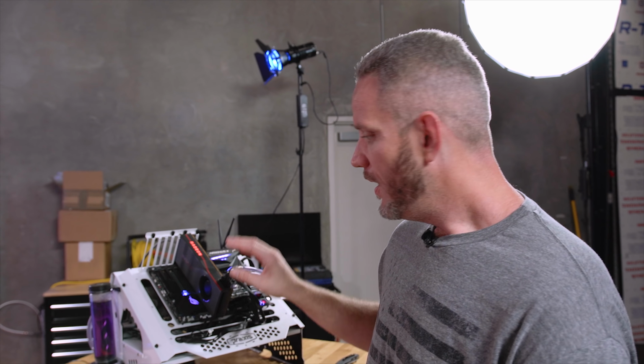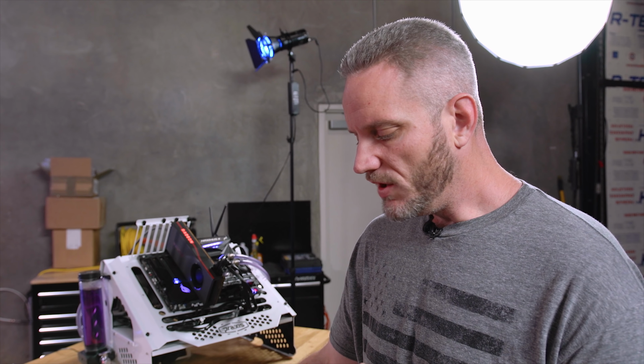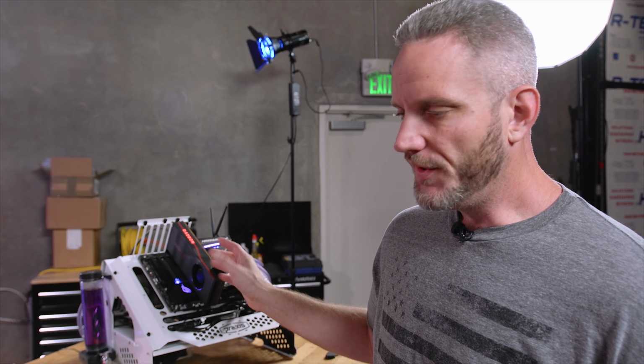But the point of today's video is I want to see, by just taking out of the box settings, touching nothing, which is, believe it or not, the way most people operate their graphics cards. They take them out of the box, they stick them in and off they go. They might play with a slider a little bit. But I want to see what will happen when we just take a water block and put it on. So we're going to compare things like edge temp, TJ max, or they call it T junction. We'll probably do a 3DMark Time Spy Extreme, because that's a huge load on the GPU, just to see what happens to our graphics score.